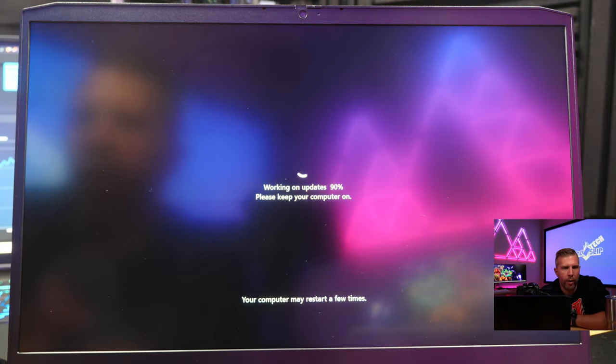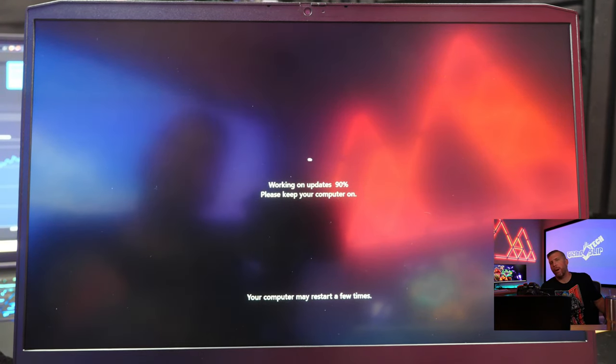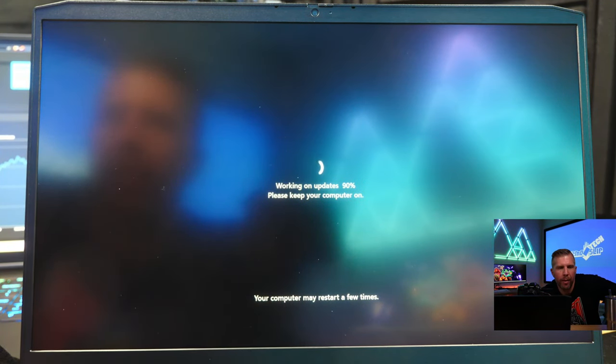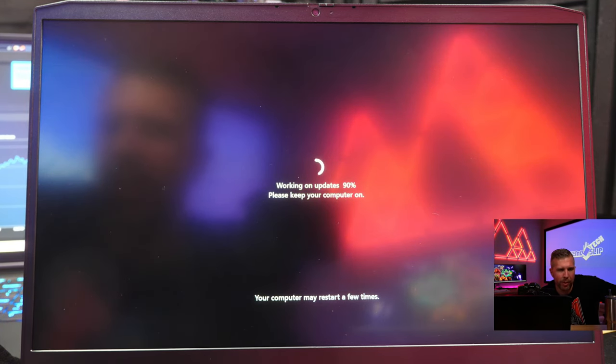Yeah, the 11400H will be faster in games. I think that would be true, probably, except for certain titles. That's generally going to be true. That said, is there a MUX switch on this machine? Probably not at this price point, but it'd be interesting to check Lenovo's settings to see if we can turn that on or off. Because if this does have a MUX switch and the Gigabyte does not, then this might actually be faster in esports titles. I'm not sure.